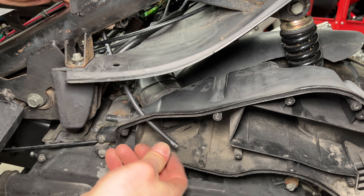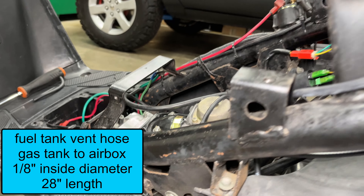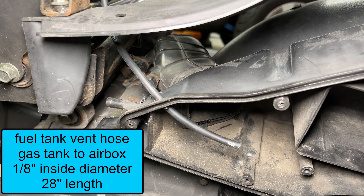I won't be using this one-way check valve. Connect a vacuum hose to the top of the gas tank — this is the vent. When the scooter gets hot sitting in the sun, some of the gas will evaporate. I'm running this hose into the air box. Next time you start the engine, extra fuel vapors will be burned in the engine instead of escaping into the atmosphere. Normally this goes to a charcoal canister, but this is simpler.